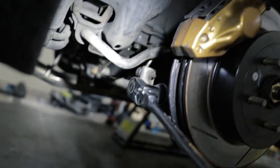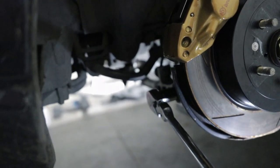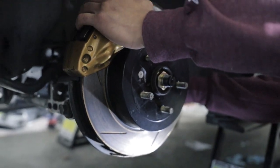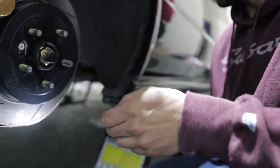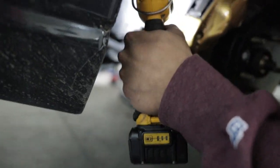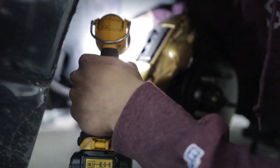Now we're going to take off the lateral link bolt that connects them both together — it's a 19. Take those off, then I'm gonna take off the sway bar, and then we're gonna start working near the differential. Make sure that you don't misplace the washer on the back side — it goes with the nut, so don't misplace that.